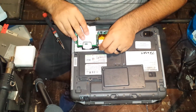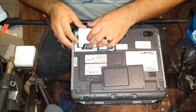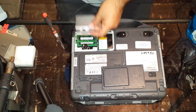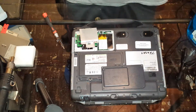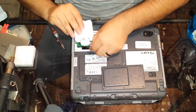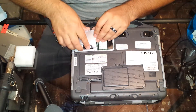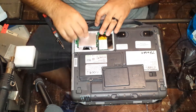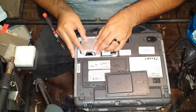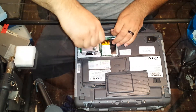To cover this up, be careful — sometimes it will get stuck. Put your CMOS battery at an angle like this, with the wires going out through this gap here. Grab the CMOS battery, have the wires come out through this gap, and let it sit there like that. Then simply slide it back into place. There's a lip here that you have to push down and slide towards you a little bit. Line up your screw holes and put the two screws into this plate.